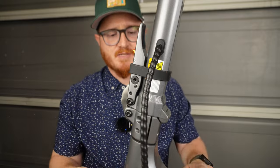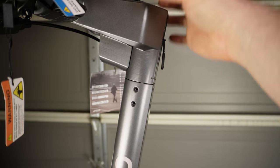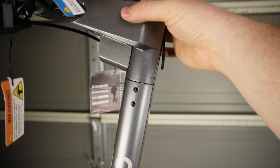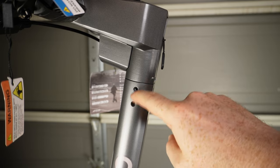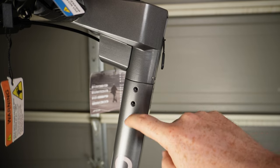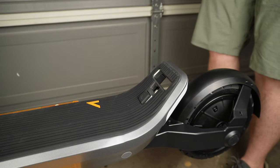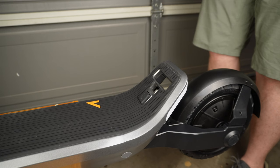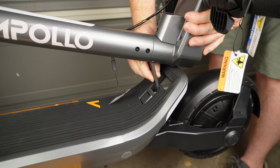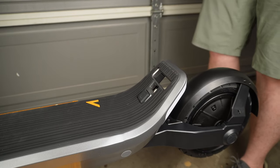Apollo provides a safety strap which hooks onto a mounting point — wrap it around the actual stem and lock it in place, doubling up on safety. For the head unit and handlebar assembly, you simply insert it into the stem, fish the wires through carefully so you don't pinch any, then visually inspect that the bolt holes are properly aligned and insert the six hex bolts — two on either side, two on the rear — and tighten accordingly. On the back, a magnetic clip folds out and locks the stem when folded.